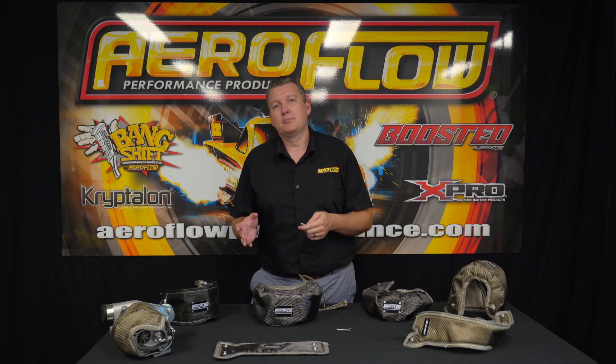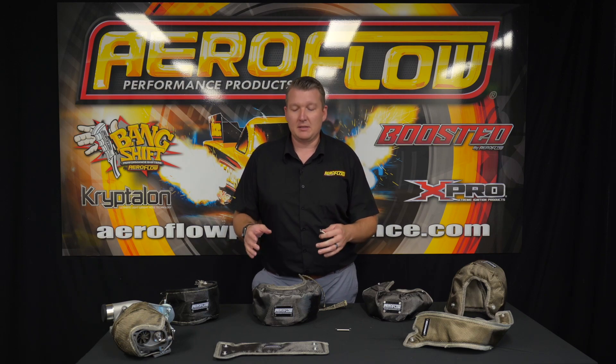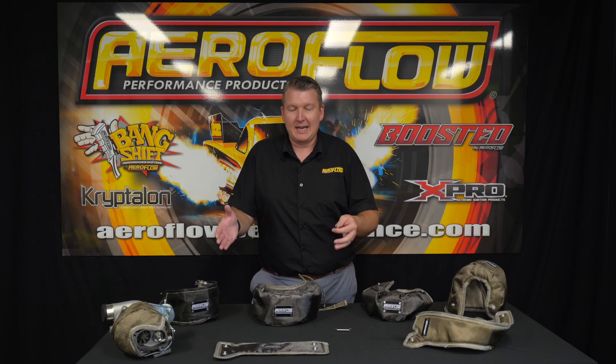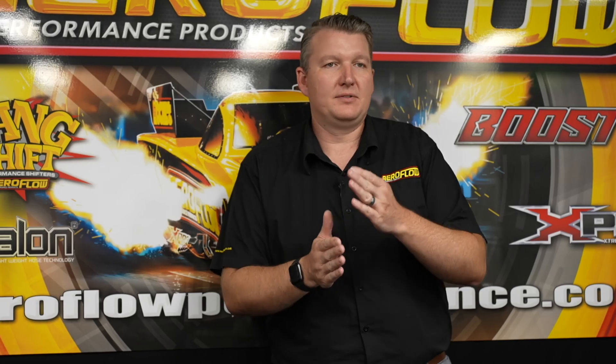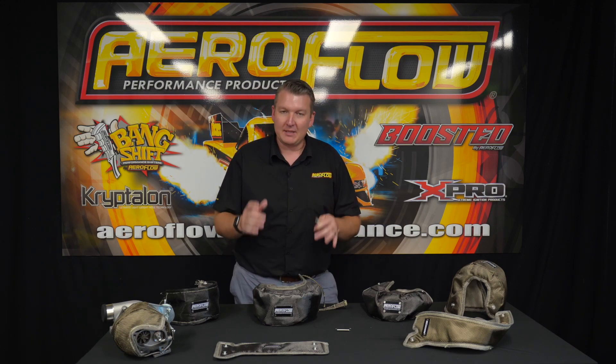There are a couple of things to remember when fitting these bags. The material inside and outside is flame resistant — but what isn't flame resistant is any contamination that gets onto the bags. If you're degreasing or cleaning your engine bay with something flammable, or if you have an oil leak and that soaks into the bag, that's what's going to catch fire rather than the bag itself. Also, if the bag is rubbing against something like an inner guard, chassis rail, or other fixed position — especially with factory engine mounts that have movement — that rubbing will cause the bag to fail. It's heat resistant, not abrasion resistant.